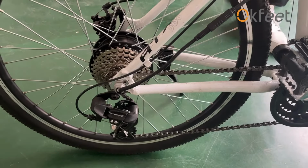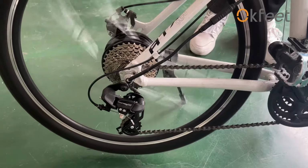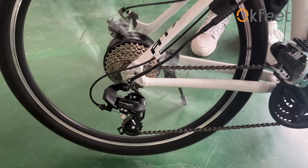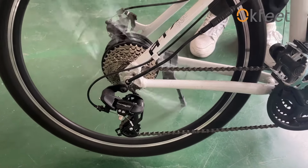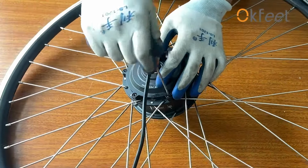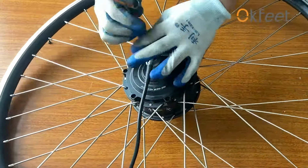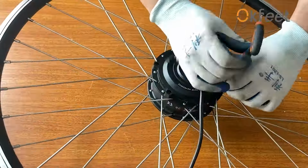If you want to know the reason why the motor has abnormal noise, you need to take a video of it so that we can prejudge if there are some problems inside the motor. If you want to know the cause precisely, you need to remove the screw on the motor shell and the nut on the other side.